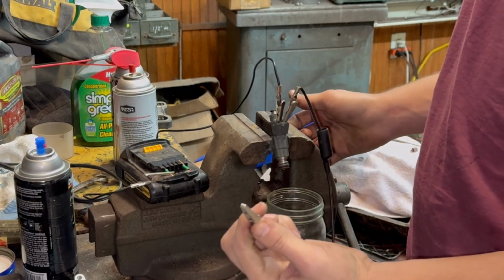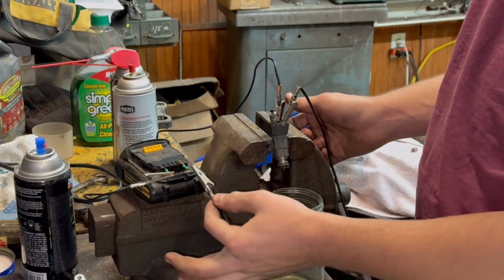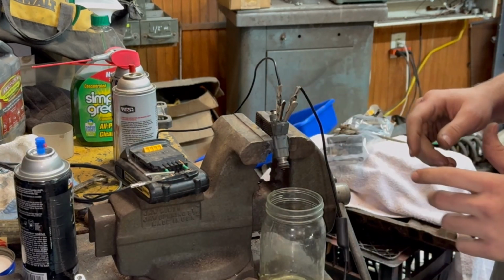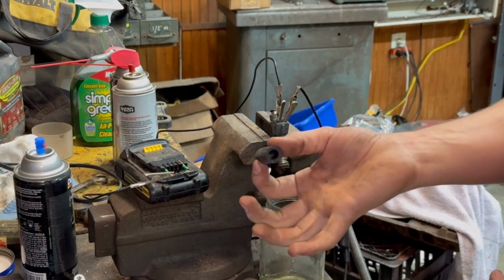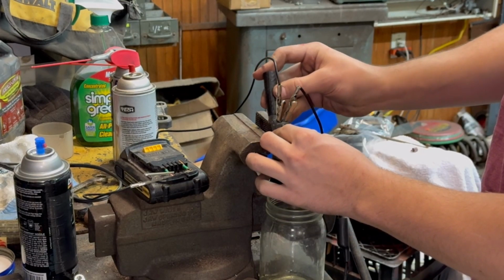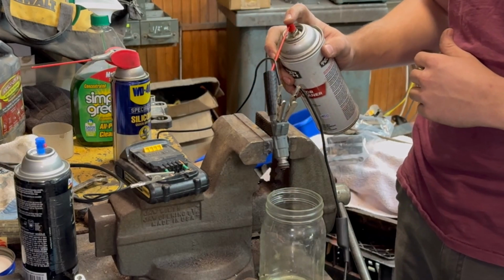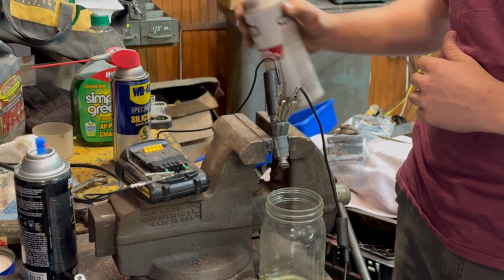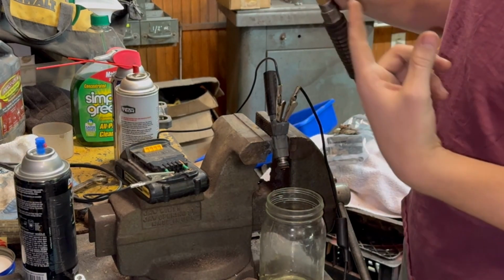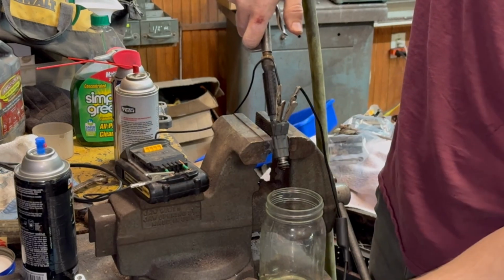And what you're gonna do is you're gonna end up tapping this on there. But that's the actuator in there going up and down. So next, got a hose that fits perfectly right over the injector like this. I've got some carb cleaner. I'm gonna fill that up. I've got my PSI. All right, I'm just gonna put this on here, give it a little tap or 2.